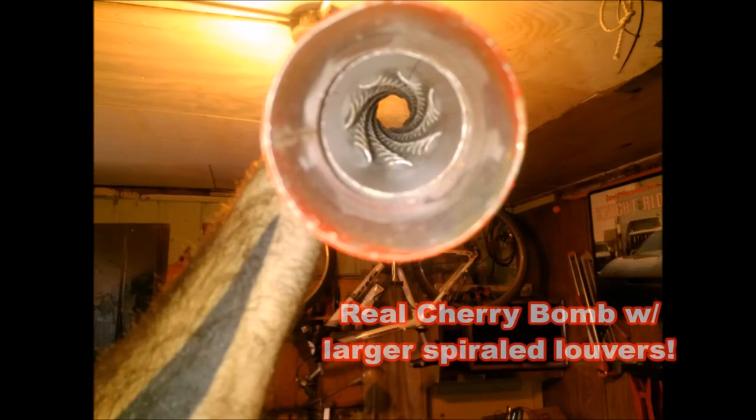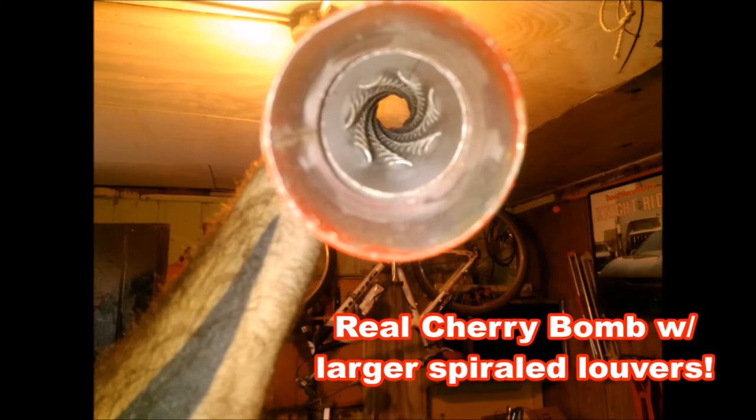This is the 345 with ported and polished heads rebuilt. I have two-and-a-quarter inch exhaust smoothly flowing down to two 23-inch length Thrush mufflers — which were supposed to be Cherry Bombs, but they bought out Thrush a long time ago. If you want real Cherry Bombs, Flow Tech makes the same style but only has one size. These are double length so they're not so loud. Right now they're just dumping out under the truck — I don't have tailpipes from them yet.